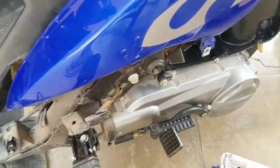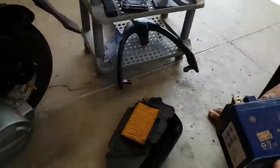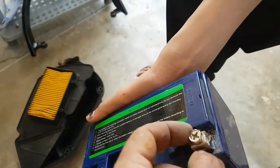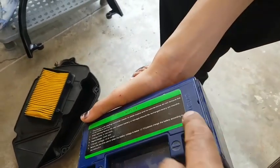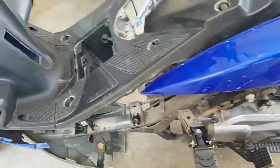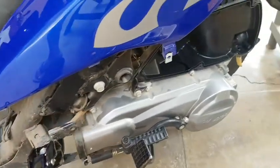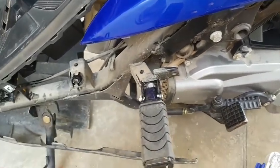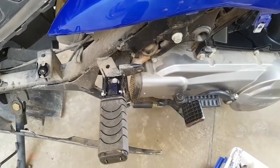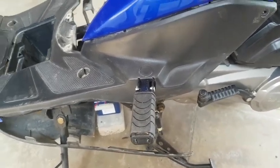For the tuning we will have to install the battery first — there it is. The terminals have a little bit of corrosion on them, so we'll apply some grease over the terminals, then install the air filter, connect the battery, and start up the scooter. We will first do the tuning, and then we will finish the cutting and assembly process.